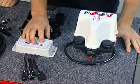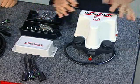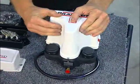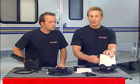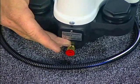Now it's time to install the BrakeRite actuator from Titan. It's like our translator. What it's doing is taking that 12-volt signal from the brake controller that's going through that blue wire, feeding it over to our actuator. And what that actuator is doing is turning the 12-volt signal into hydraulic pressure. The harder you press on the brake pedal, the more voltage it sends through. The more voltage that comes in here, the more hydraulic pressure that comes out, and out of here it goes to your disc brake assembly.